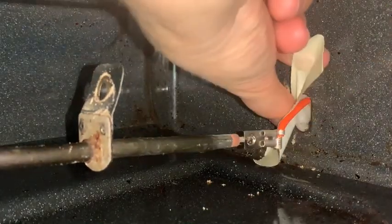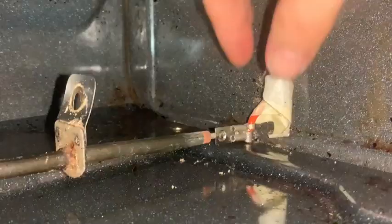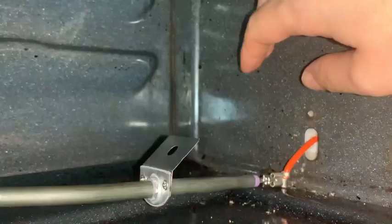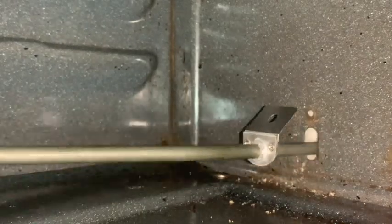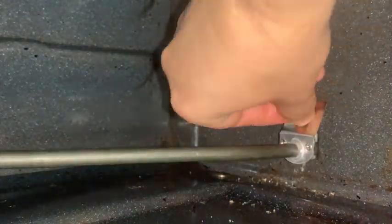Gently remove the wire element out, the old one, place the tape around the wire to make sure it doesn't fall to the back. Remove it, go ahead and attach the new prong fully, remove the tape, and go ahead and attach the screw.